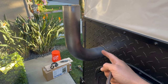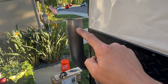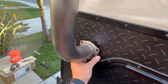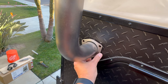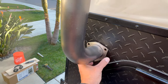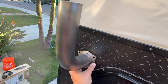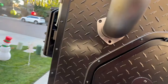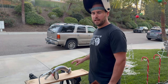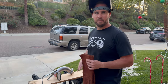I chopped some of the 90 off and slid it into the camper. Now I'm figuring out how far down to chop this portion of the 90 to fit the chimney on top. I'm also going to use a regular two-and-a-half-inch exhaust flange — get that welded to this tube, then bolt it to the camper so the chimney portion is removable if needed. I'll put some silicone around it to make it weather tight. We've got the exhaust piece with the flange set up to weld, and we'll send it off to powder coat some other day, but I'm trying to get this all sealed up before any rain comes.